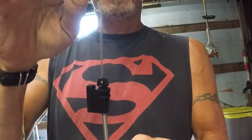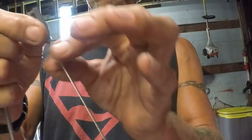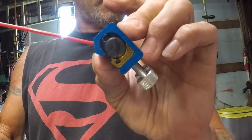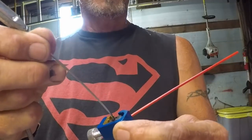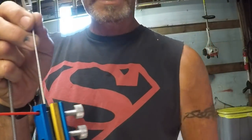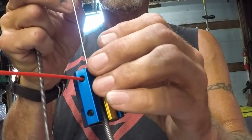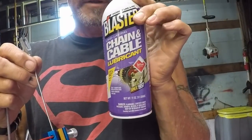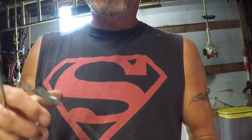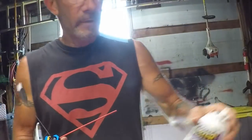This is the end that goes against the engine, and this is the end that attaches to the handle. So we're just going to go this end. There's a little hole in the end of the lubricator — you just slip it on. Make sure that cable goes into the center of the hole. Then you pull it down until it is as deep as it will go. You don't yank on it really hard. Then you just simply turn these screws down and that will compress that rubber around it, seal it, and allow you to use the rubber straw and your preferred chain and cable lubricant — mine just happens to be a PB Blaster product — and squirt it until it comes out the other end.